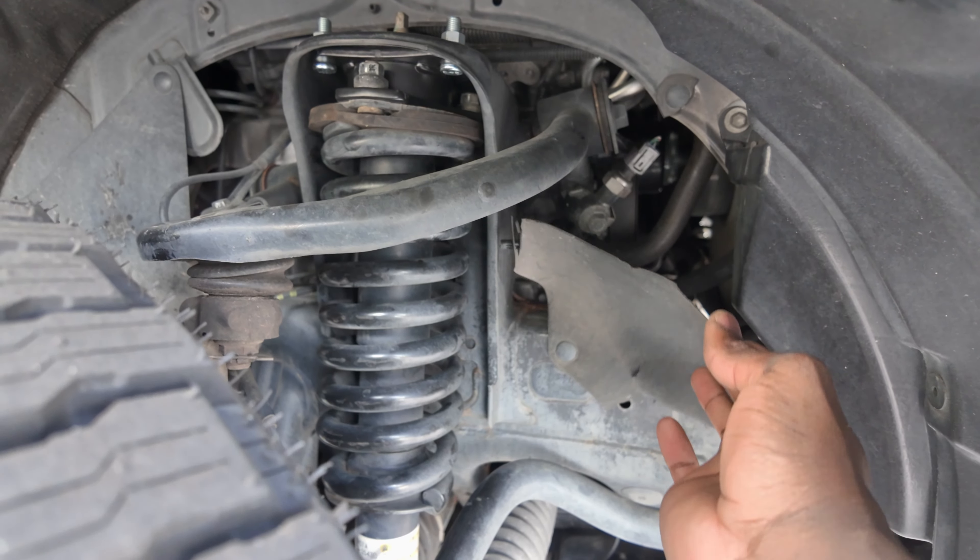So we've got to figure out how to do this. I bought a Dremel today and I don't even know how to use one — first time live, coming at your boy. The good thing is there's a bolt down here, and it looks like if we take that out — it's a Phillips head — we can actually just push everything forward. I'm missing a bolt on the bottom and I'm not exactly sure why, but I'm thinking it'll hold even without it. I'm just going to take those bolts out, trim a little bit, push everything forward, and hopefully get rid of that noise.